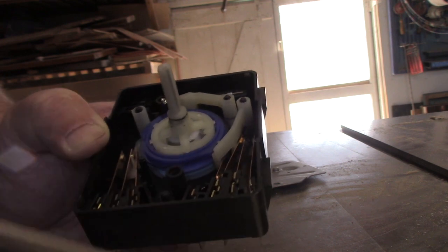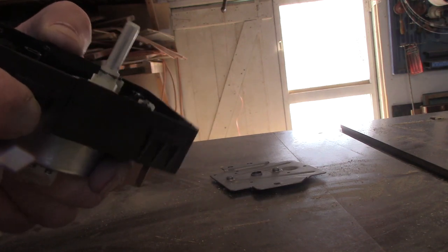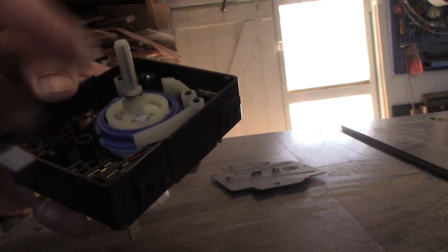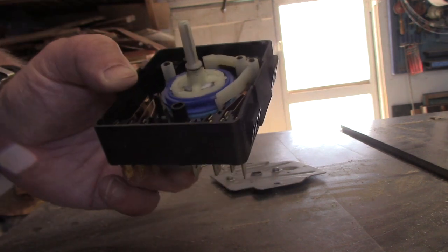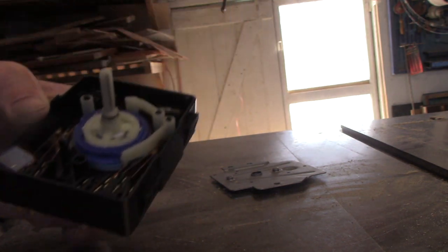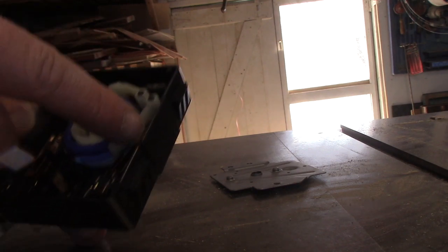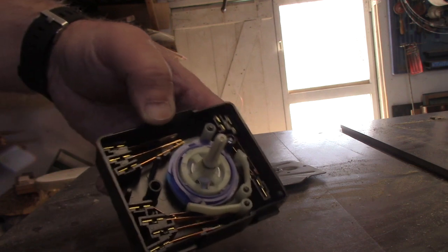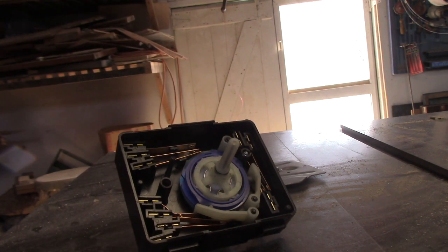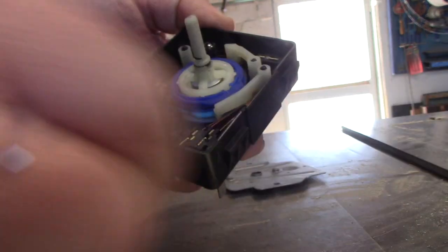As you can see, it is currently loose. I'm going to go get the knob so I can run the machine through its various cycles with the hopes that I can see something that's not going right. I can tell you that I see a tremendous amount of arcing and discoloration on the tips of these two contacts. Unfortunately, I can't remember if that's from when they were fused together or not. Seems like the kind of thing fusing together would do. Rotating it around, everything is working.